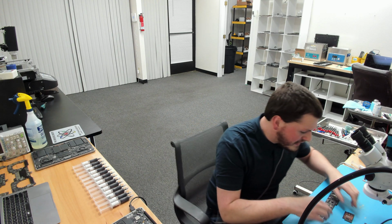And what that tells us is that the heatsink was actually not touching our processor. If it was squished down onto that thermal compound, it would have created a little bit of a vacuum, and it would have given us at least a little bit of resistance. Now, let's actually have a look at this heatsink and the CPU under the microscope and see what we find.